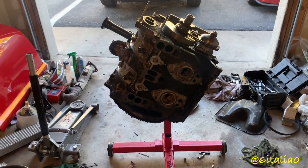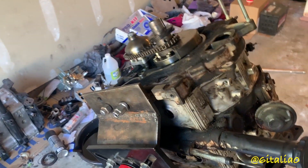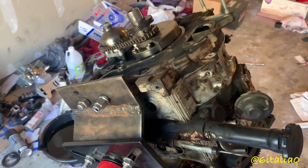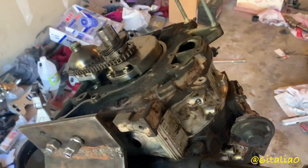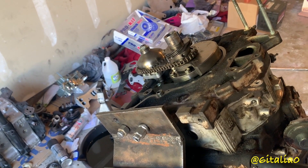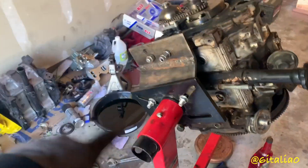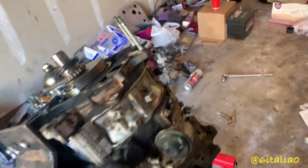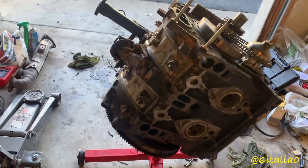It is possible to fix this, and there's a trick referred to as the ATF trick. When the engine's in the car, you take a spark plug from each rotor out — just keep in mind it'll destroy your spark plugs, so have a new set on hand. You put the ATF in through the spark plug hole. You turn the motor by hand using a ratchet and a 19mm socket on the front bolt. The total amount you want in each rotor housing is two ounces, so four ounces total. Then you just keep spinning it to get even coverage.